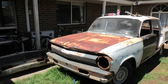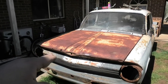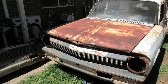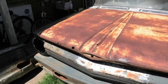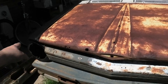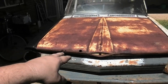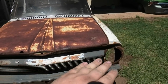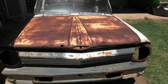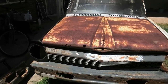Starting off when you're looking for an EJ or EH Holden: EJs have their own unique grille and bonnets. EJs have a big rib that goes down the centre, a badge on the front, some chrome that sits above the headlights across the grille, and they have eyebrow moulds which are super rare. If you're buying an EJ, make sure it's got them — don't buy one without them because it's taken me three years to find one pair and normally they're really expensive.